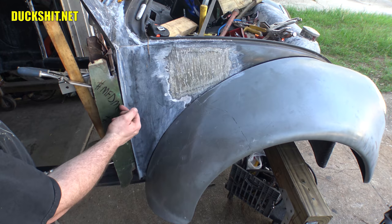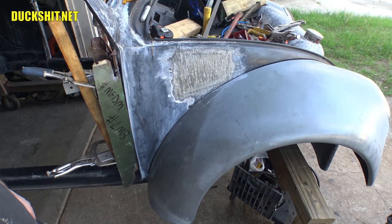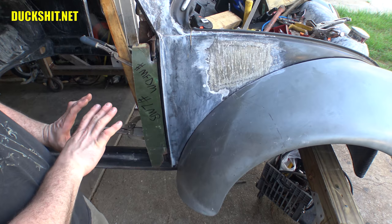I don't want to have it accidentally chip off paint, especially after I'm spending all that money having Earl do my beautiful paintwork on this car. I want this thing to be right and I don't want it to have a problem again down in the future. So one of the things that I will be doing is cut the gutter off of here and then, like I said, I'll move the hinges over just a little bit. I might even push them into the door a little further because that will change where the fulcrum is at and change how they pivot.